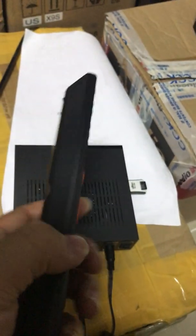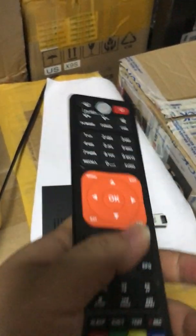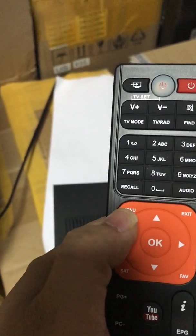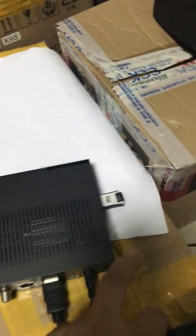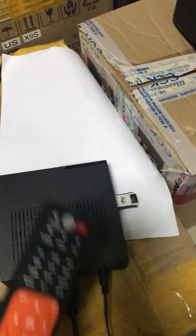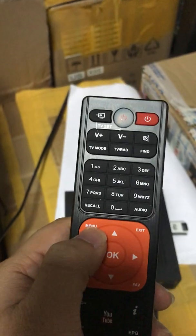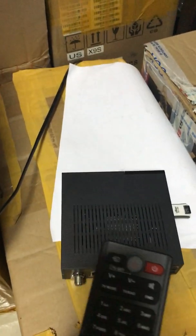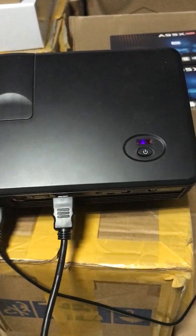I have already installed a matching battery inside the remote, so now it's powered. This menu button is very important for the force upgrade procedure — when I power on the V9 Super device after plugging in the USB disk with the .abs file, I need to continuously press the menu button to force the device to access the upgrading page. Now I will power on the projector.